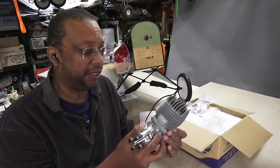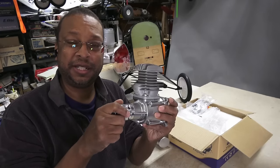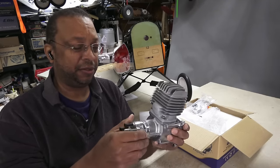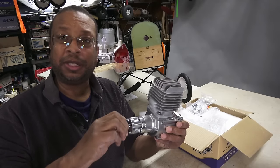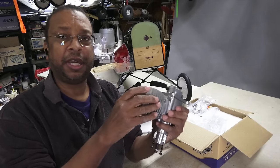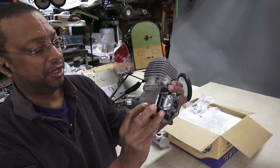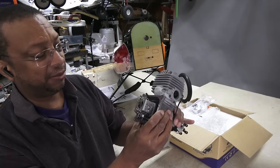For motivation, this will have what I understand is a relatively new engine — the Stinger 63cc. They apparently milled it out to get an extra three cc's from a 60-size engine. I haven't had a Stinger engine this big before. It's an interesting looking engine with a cast head and cast body, though there's a color difference between them, suggesting slightly different casting or post-processing on the crankcase.